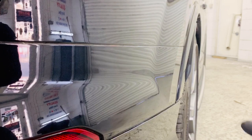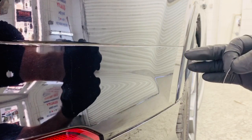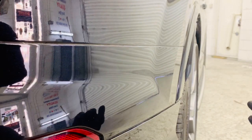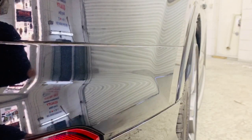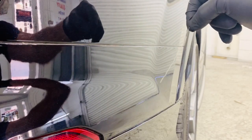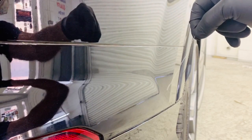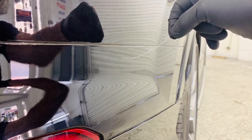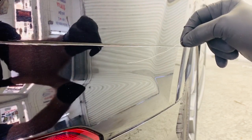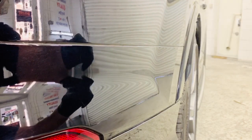What is static? Static is basically an imbalance in electric charges on a panel. This can be created by simply touching the panel — every time you touch, wipe, or tack-rag down a panel, you're creating a charge in it. A simple way to show this is by using this thread. You can see how this bumper has a lot of static — just from wiping it over once, it pulls the thread almost vertically towards the panel. As it's pulling this thread towards the panel, you can imagine what it does in a spray booth: it could pull contaminants onto your paintwork, and if you're spraying metallics, it will pull the metallic flecks down onto the panel unevenly, affecting the finish of your job.